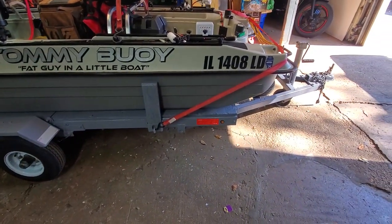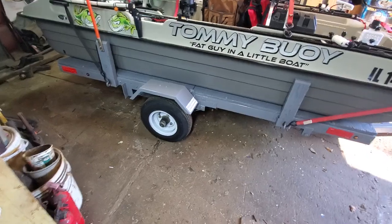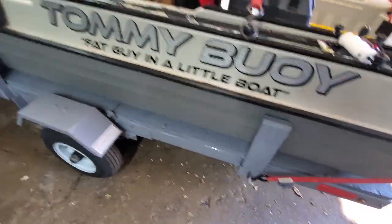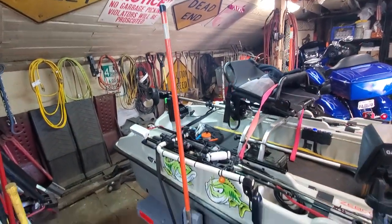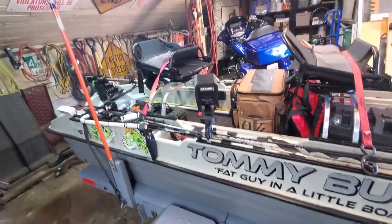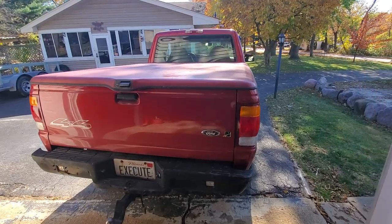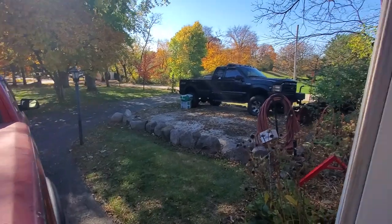Just a piece of three-quarter inch decking on it. I redid all the lights and wiring because I don't play that game. Threw a new set of tires on it. These are oak 2x4s from a pallet — just got some simple side stays on there. Those are all plow marker poles from a snow plow laying around. Those worked out great for backing it up when the boat's not on there, because this thing is so short you can't see anything. Even with my little Ranger, which I typically pull this with, I can't see the trailer at all, let alone pulling with any of my other much larger vehicles.